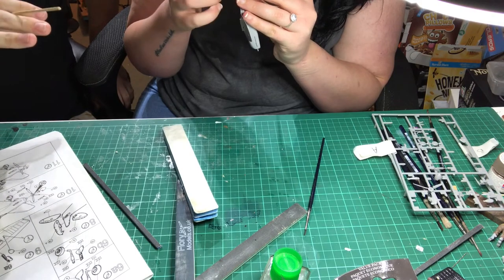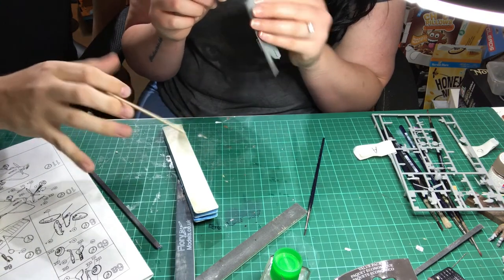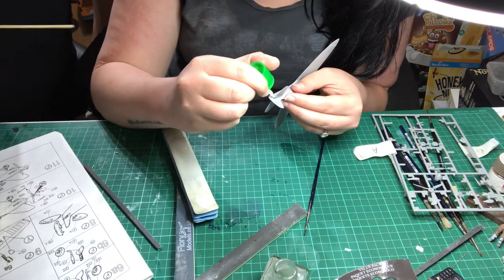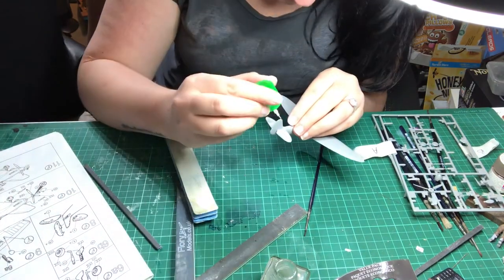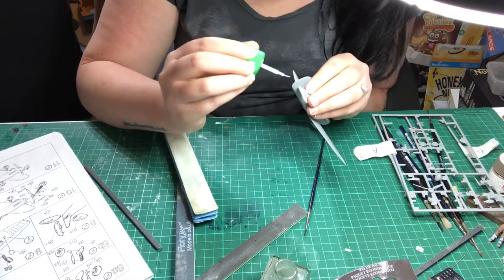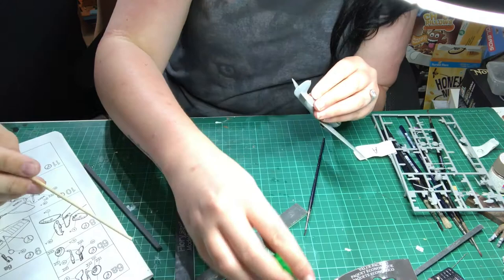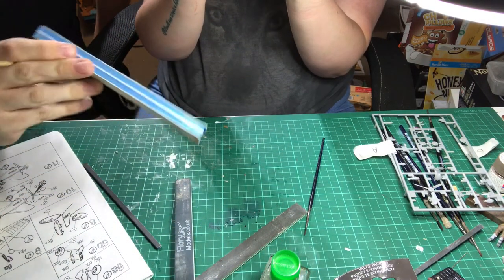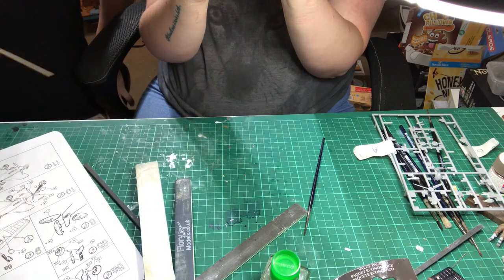natural way it was manufactured. So it's come back to your sort of semi-shiny plastic again. And it works wonders if you're doing canopies and you've got a canopy that's a bit rough, and you take the seam out with the coarser sanders and sponges. And then once you've done that, you just literally buff the scratches out with a buffer.